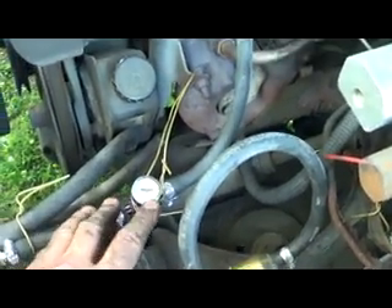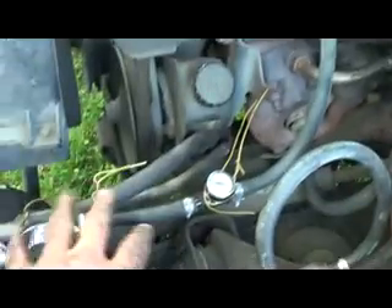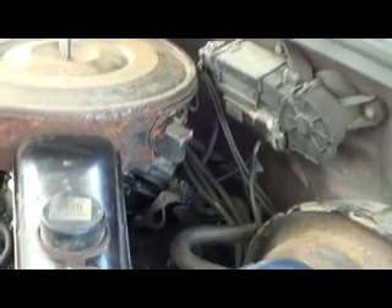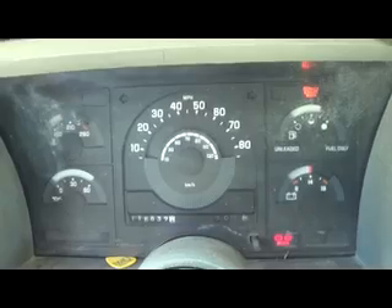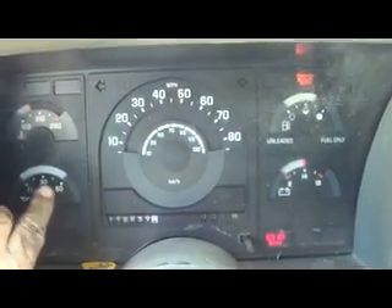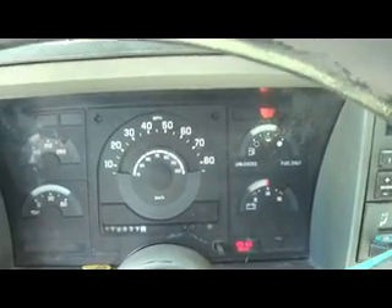I got my fuel filter, my fuel pump, and I put a fuel pressure regulator right here because it was reading 10 pounds — if I left it at 10 pounds it might blow the seats out. You're only supposed to have about 5 or 6 pounds. I'll go through the whole thing again, then put the distributor in on a different date. The only thing is a check engine light came on, but the gauges are all working fine. Everything is working as it's supposed to with the computer still in there, and the timing did advance — I just wanted to see where I was.